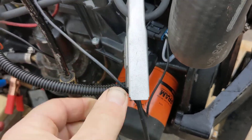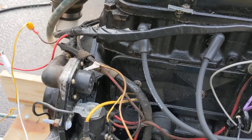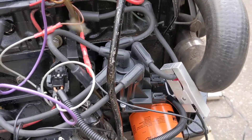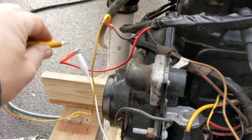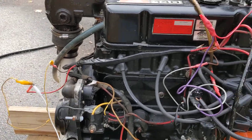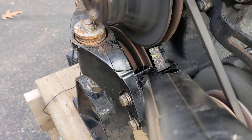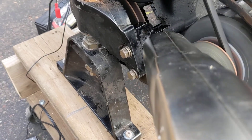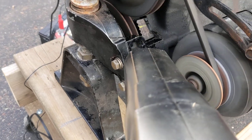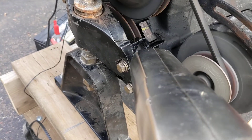So I've connected my white loop. I'm going to hook my timing light on number one cylinder — timing light's all set. Now I'm going to start this without connecting the shift interrupt. With the white loop connected you can see it will not kill the engine; the engine is still running. With the white connected, your shift interrupt will never work. For my timing, the original spec is six degrees before top dead center. The manual says zero but that's for the newer engines. I'm going to keep mine at six because it does not advance very far.